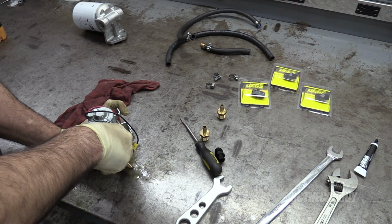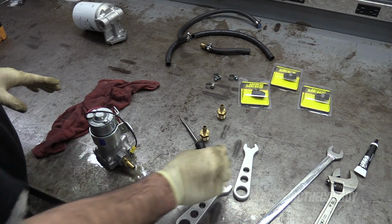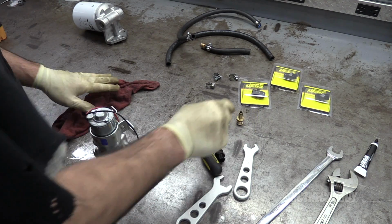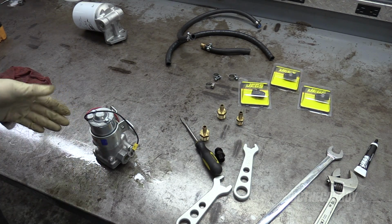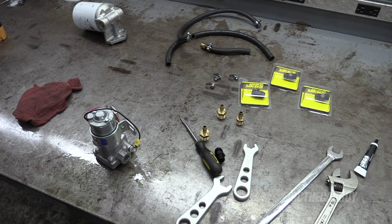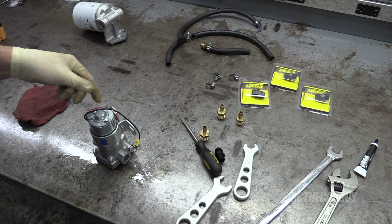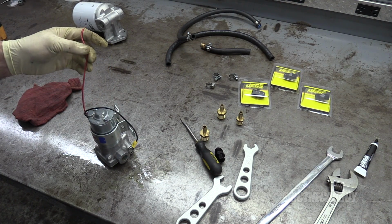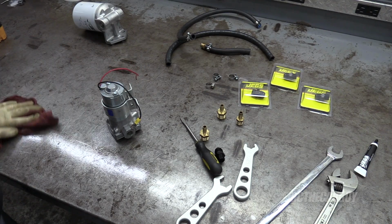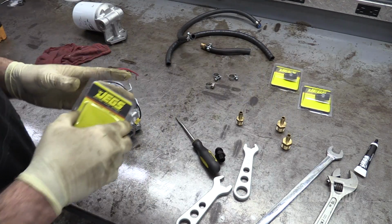I'm also not going to use this ground, because that would be the perfect thing to use on a kill switch. If you interrupt the ground, you can use this as a kill switch so the fuel pump would never turn on. I was also going to do the same with the ignition. So I was going to take the ground for the ignition module and the ground for the fuel pump, run them through a switch, because ground side switched, make it so that that would be my kill switch. So I would be turning off the fuel pump and the ignition. So my own makeshift immobilizer.